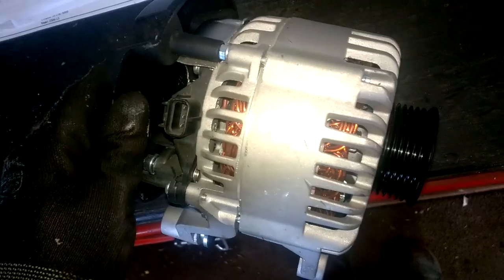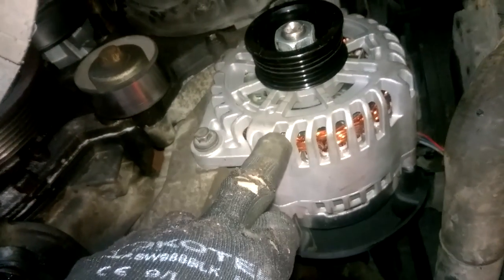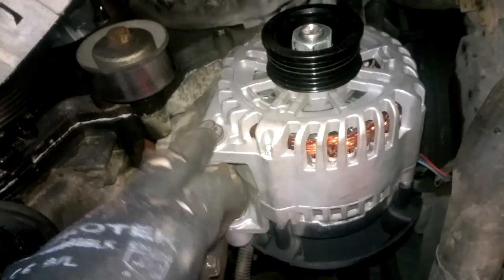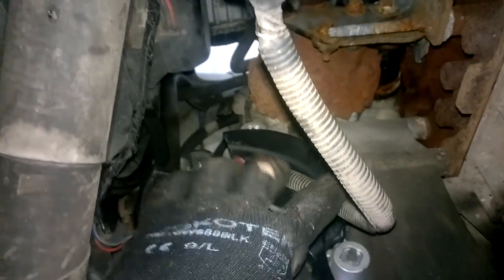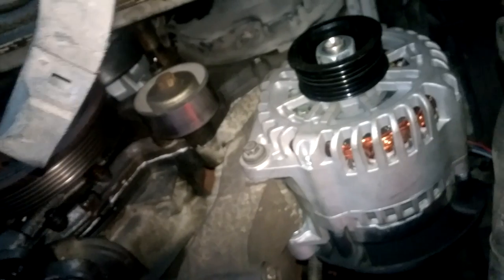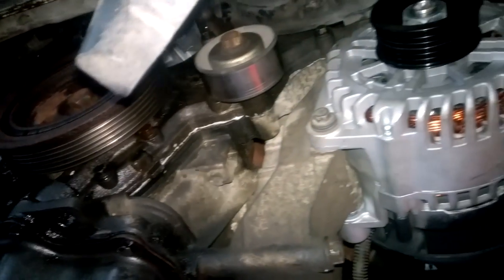This is the new alternator that will be going in now. The new alternator is back up in place — two 10mm bolts holding that up, and on the other side there's another 10mm nut holding on the cable, plus a plug socket you need to reconnect. That's back up in place. I'm going to put on the drive belt now, top up the coolant, and run the vehicle. It's all back together now and ready to go.